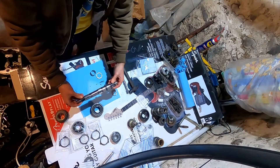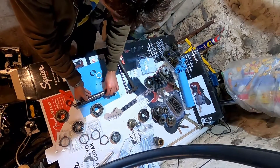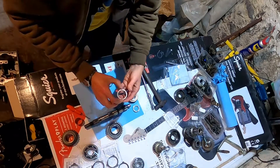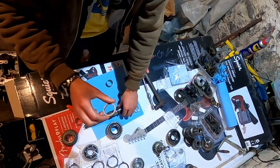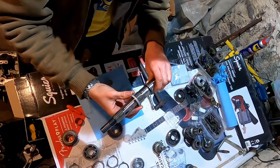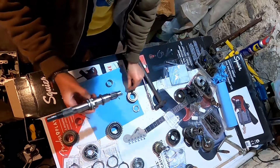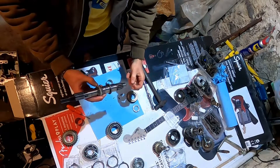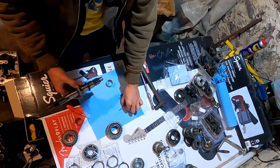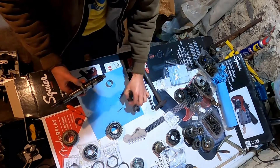So this is the gearbox main shaft, and the first things to go on this are second and third gear. However, they're a bit tricky, because holding them in place you've got these little lock tabs. You put them on here, and what you've got in the middle is a spring pushing in the middle of two of these little detents. They're tiny and I really don't want them to ping out and go everywhere, but it might happen. I don't have spare ones of these, so that would be a disaster.